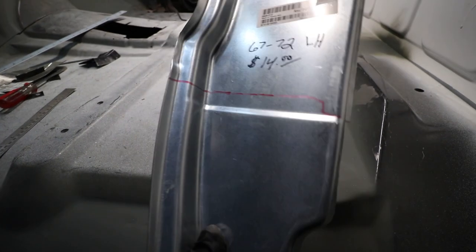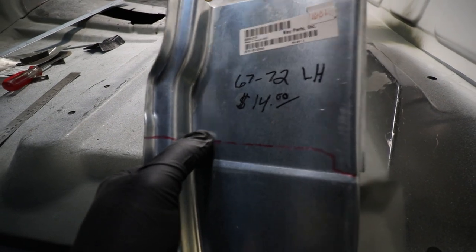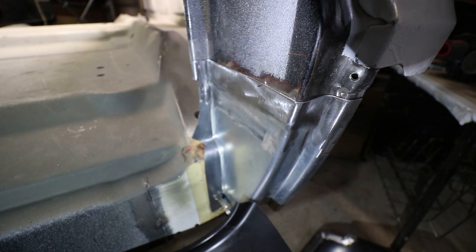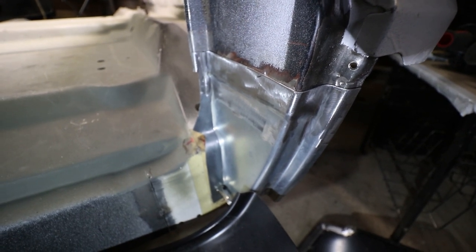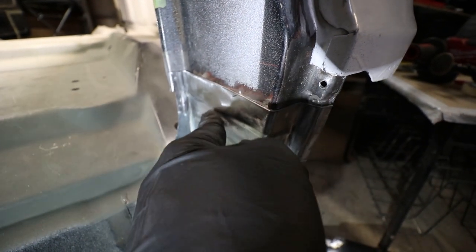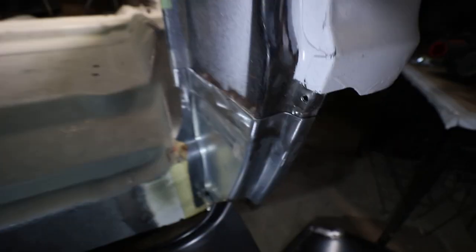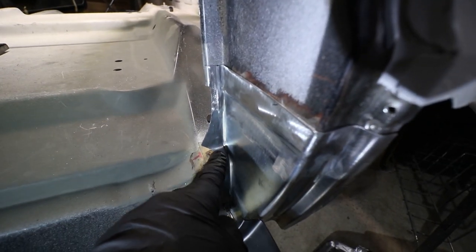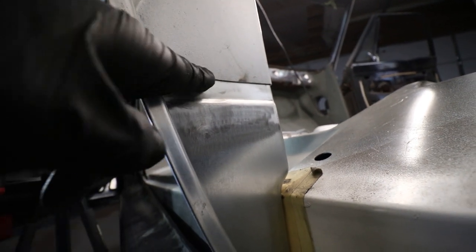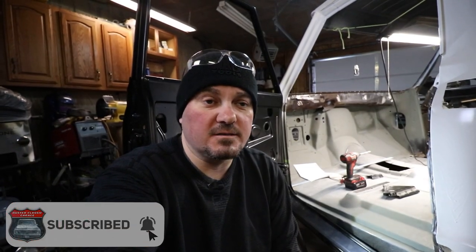I already started — I put this thing in place and figured out where it's going to sit. Once again, if you watched my other videos, I'm going to cut a little bit higher above that just in case this is too short. So far, I'm pretty impressed with this panel. This thing is sitting exactly where it needs to be. I took some measurements — from this point all the way down to where it starts dipping down, it's 12 inches. I even measured from the floor to this piece, and that's exactly like it is on the other side. I might have to do a little bit of modification here, but for right now I'm going to go on the back side of this panel and scribe this line to get a finer cut so this fits almost perfectly. If you guys enjoy videos like this — the restoration process and these old trucks — make sure you like and subscribe and hit that bell notification so you know when new uploads are available, because I'm going to be cooking on this thing over the next couple months.